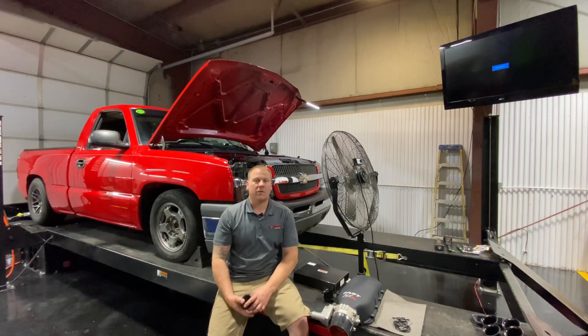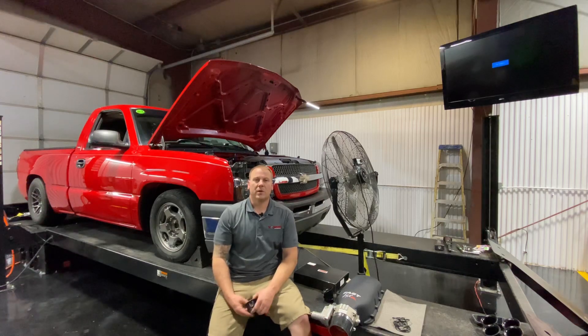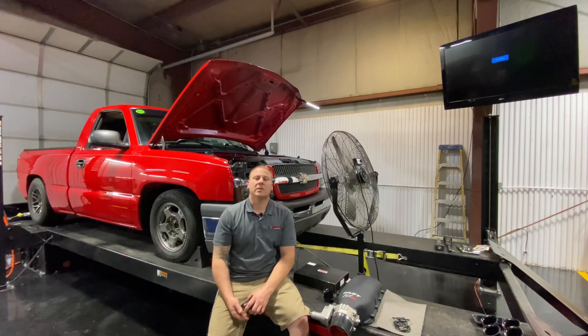The engine doesn't want to slow down, but I think the intake is kind of just sitting there and plateauing at that point. We're going to run these velocity stacks right now and then make a couple more test runs and see if we can't squeeze out a little bit more power.